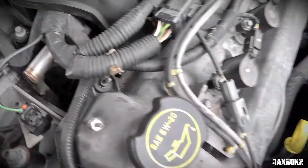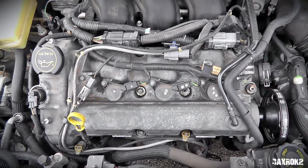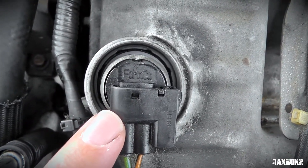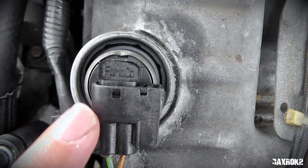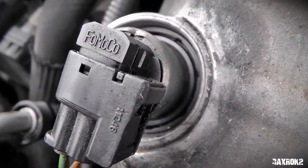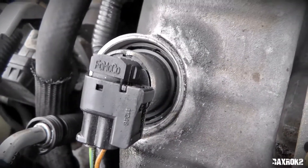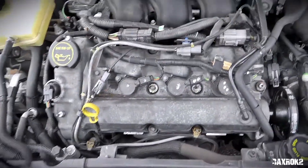It was quite a challenge to find the seals because nobody makes them and I couldn't cross-reference a Ford part number either. I was able to find a source for these seals and I put that link in the description — I paid about $20 for both of them. Getting them in and out is pretty easy: I knocked them out from the inside of the valve cover and pressed them back in from the top down. If you buy from the source I've linked to, you're going to get a good part.